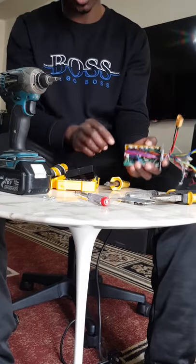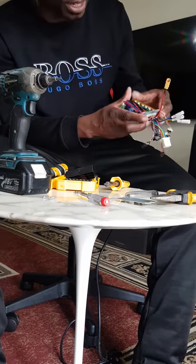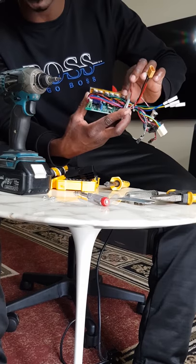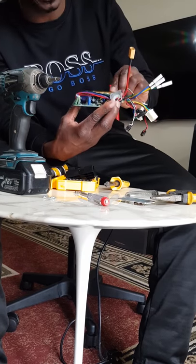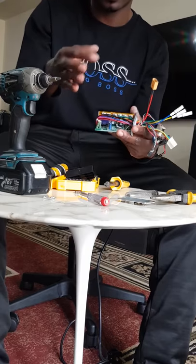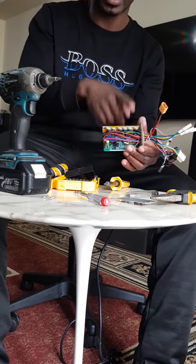There's another way as well: people test this by visualization. They just look at individual MOSFETs, and if any of them shows a bit of a different color, a bit of a bend, or there's a crack on something, then they'd say, "Oh yeah, that's a culprit," if you don't want to use the multimeter to test them. So if you find that one, you put your attention on it and then see how you're going to get that one out.